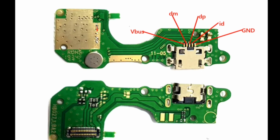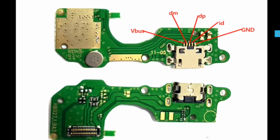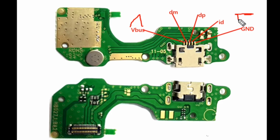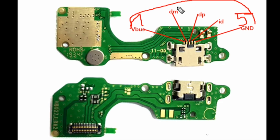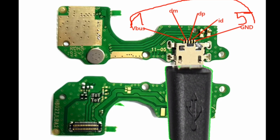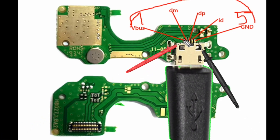If your phone is not charging, you have to check these pins — pin number one and pin number five. These are the charging pins. You have to connect the USB here and take your multimeter, put the probes — probe one and probe two. The multimeter has two probes; use them to check if you are getting voltage or not.